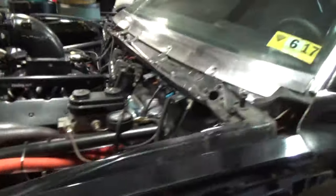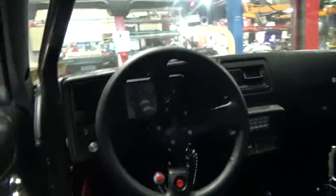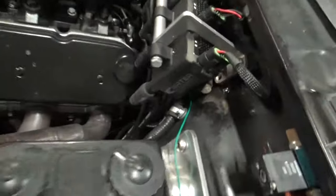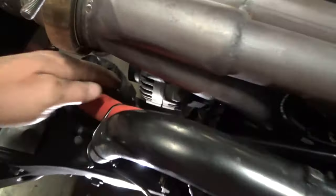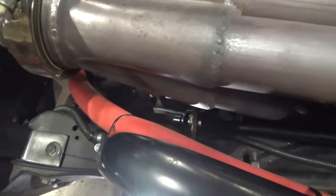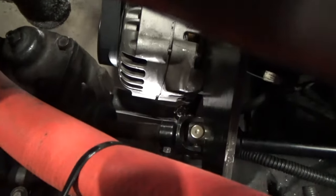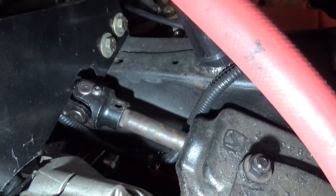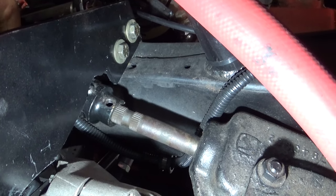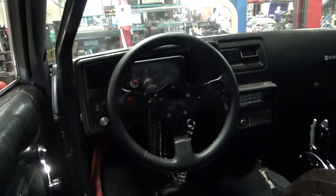I'm wrapping this project up but my steering wheel is a little bit off-center. Luckily this is a race column so I can loosen up that collet and loosen up this splined Borgeson universal, and I should be able to just re-clock it on the steering gear — shouldn't be too big of a hassle. He's way down in here — one more tooth — and that'll do.